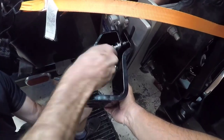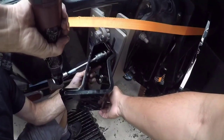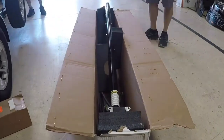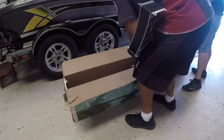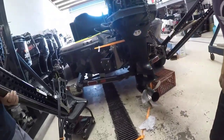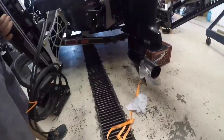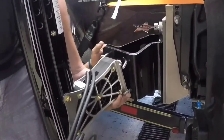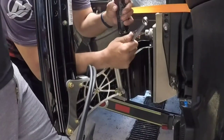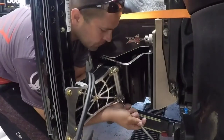Gil's got a fancy electric ratcheter, but really all you need to install this is just a ratchet set with an extension. With that bracket mounted, we're ready to take out the second power pole. It doesn't weigh anything. This pole mounts directly to the bracket on the jack plate with four bolts — very, very easy to install. Just make sure you have an even tightening as you go around.